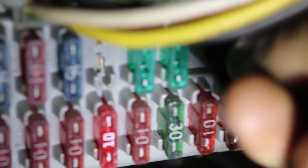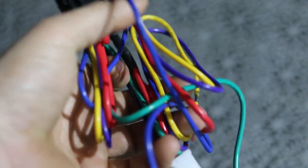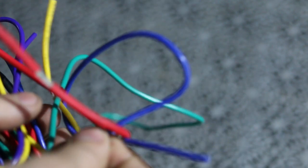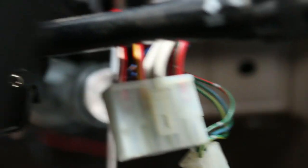Some of them are ignition 2, so the only thing I need is to use a multimeter and see which one is ignition 2 and then use that. And then finally we have this bunch of wires. This looks like a lot, but fortunately I'm driving around in a dinosaur without a CANbus system. So for me it's pretty easy — the red wire needs to be connected directly to the battery, the green wire needs to be connected to the headlights, and the blue wire needs to be connected to basically everything else: the city lights, the tail lights, and the license plate lights. I've just disconnected the light switch and the plug is right here. If you look closely you can see the red and green wire on this side and the red and white wire on this side. So if I'm correct, I need to hook up the green and blue wire to these two wires and then the system should work.